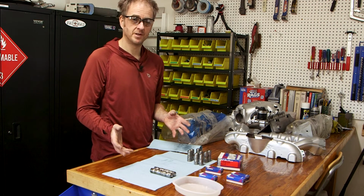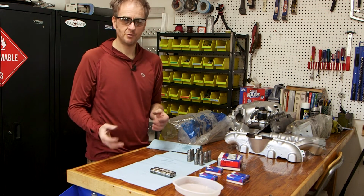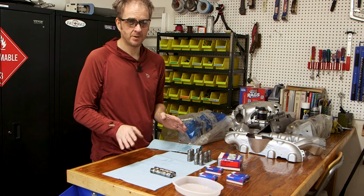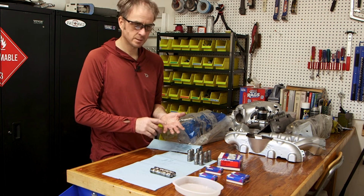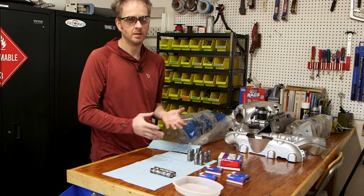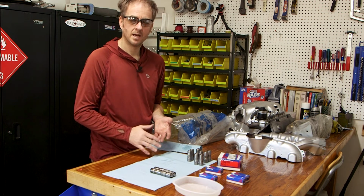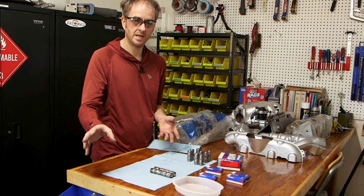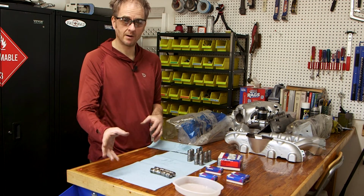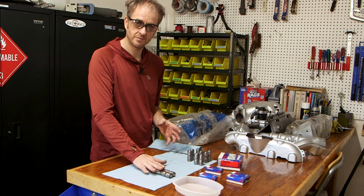So that's it for today's video. It's unfortunate. This happens a lot more often than you would think it would. If you order parts, especially from Amazon and eBay, those sites are rampant with counterfeit parts. Things like spark plugs, bearings, if you order an SKF or a Timken bearing, it's going to be a counterfeit bearing. It's happened with lifters, and it also on this engine happened with main bearings. Hopefully that $120 I just ate will help you out. So if you're doing this, you'll know what to look for when looking at lifters to see if they're counterfeit.